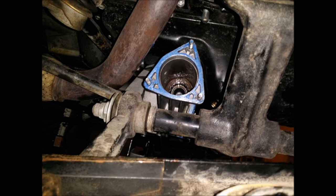Source axle nuts — these are M18 by 1.5 — you won't find these at any other parts store in Sweden, so buy them before you begin the project. Also get the gaskets that go into the differential itself. In my case I damaged mine when removing it, making it impossible to reuse them. Given how long it takes to get stuff shipped from Russia or Ukraine, I used Permatex blue sealant. You have the benefit of this video — learn from someone else's mistake and buy some extra gaskets; they're cheap, easy insurance.